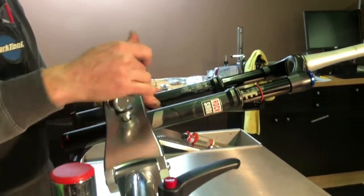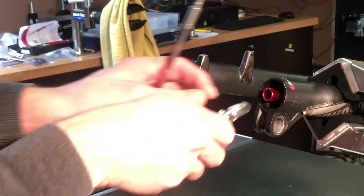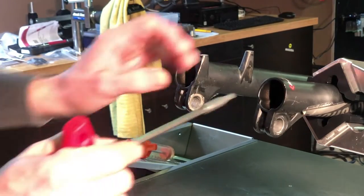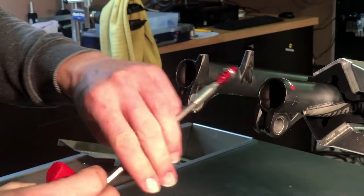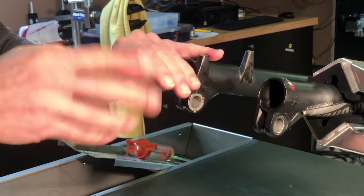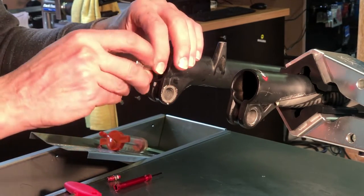It's recommended that for the next steps, you use a bench mount workstand to hold the fork while doing the RockShox Reba lower leg service. The rebound adjuster consists of two parts. First, take out the rebound adjuster shaft, and after you've removed this shaft, you can take out the rebound adjuster with a long 5mm hex key. The air spring is tightened with a foot bolt, and using the same 5mm hex key, you can remove this bolt as well. There can be quite some stiction between the bottom of the damper and air spring and the lower leg, so you'll need to knock these out with a hammer.